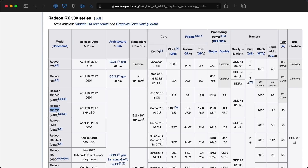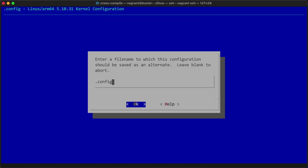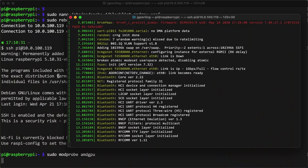Next up was the Radeon RX 550. I chose this card because YouTube user DJHG2000 noted it's a newer generation than the 5450 I tested before. Because of that, it uses the newer open-source AMD GPU driver instead of the old and less-maintained Radeon driver. I used the external riser again to make sure it had enough power, and I recompiled the Raspberry Pi kernel with the AMD GPU kernel module. I also installed the firmware AMD graphics package, and when I rebooted — yet again — total system lockup.